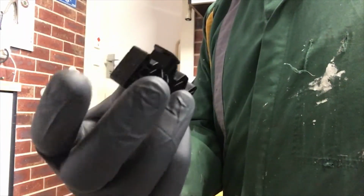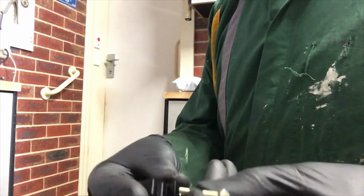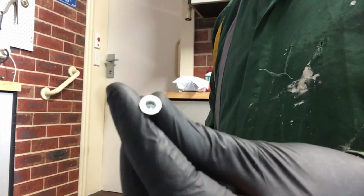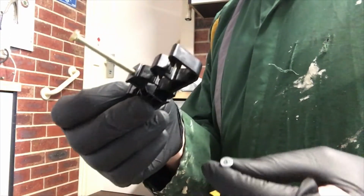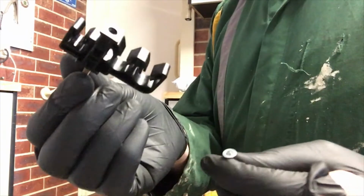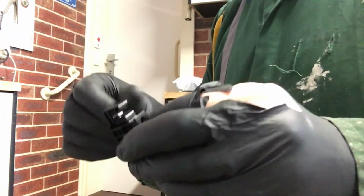Under the car I've got these fuel line clamps, and I've got little bolts that go in there, and I've also got these nutserts. So I'm going to drill underneath the car and put a hole for each of these, and then mount these onto the nutsert, which actually goes in that way. And then I'll just clip the fuel line into that, so it'll look nice and neat and tidy as well. So let's give this a whirl.